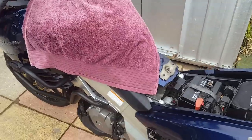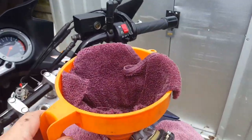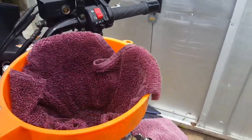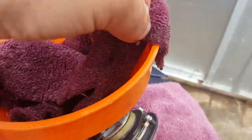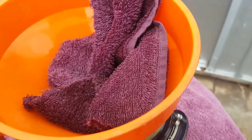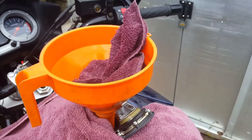It's all back together. I didn't get any new fuel. What I've done is filtered the fuel I took out of it — I used a towel to filter it, and obviously there's the gauze. In fact, there's nothing in the gauze, so that will have filtered out any decent-sized particles. So let's get rid of this lot and give it a start, I hope.